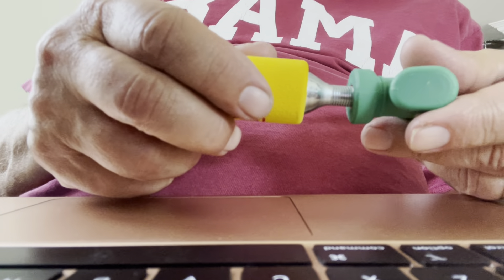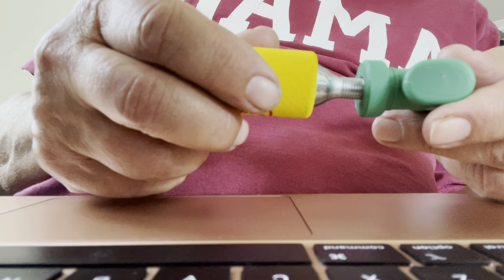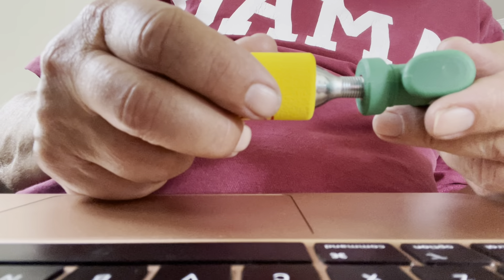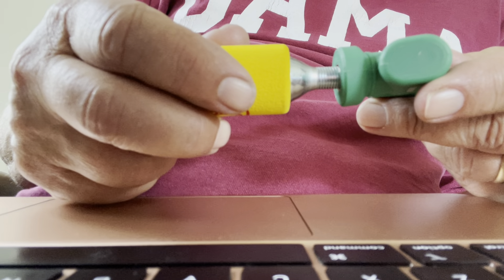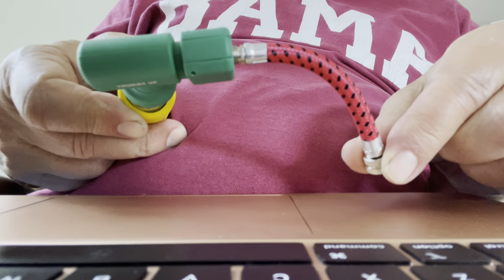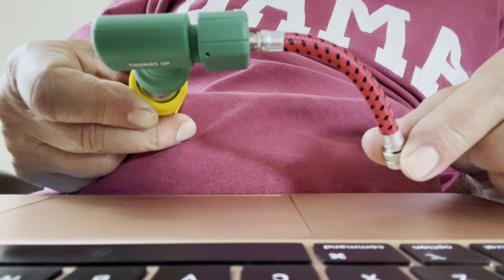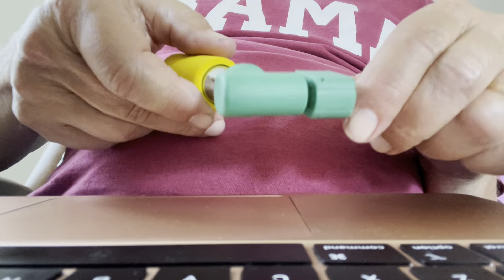You put that in and it eventually punctures the CO2. Then link the other side of the YPT 102-E extension with the bicycle, motorcycle, or car valve. You put this on the tire and expand the two wings of the YPT 108 regulator — these are the two wings.